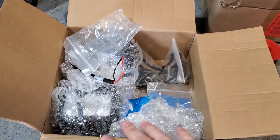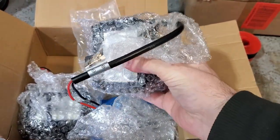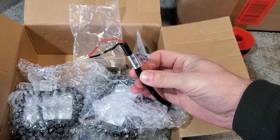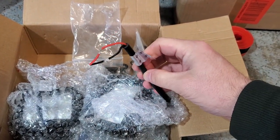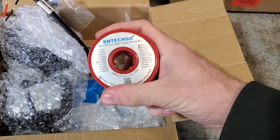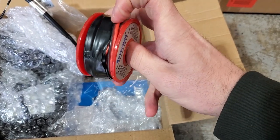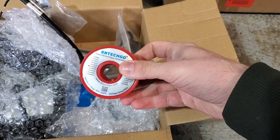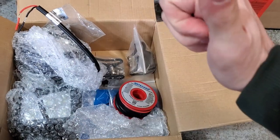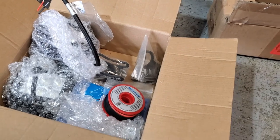These are the leftover pieces from the trail light kit that I got — it came with four of these. The only harness it came with was the two wires attached to each light. So what I've got here is some 22 gauge dual strand, positive and negative, black and red wire. We'll be using that to loom these together, the two that are on the hood back there, and we'll route it properly through the engine bay and connect that to the battery.